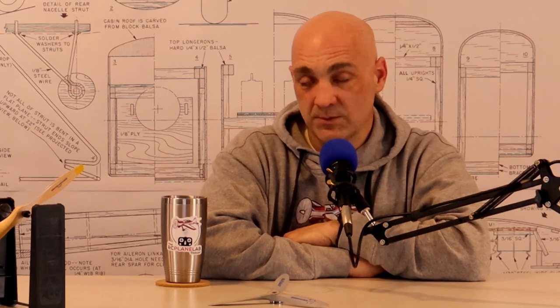It's the same idea. You just figure out a way to mount your spinner onto your spindle and set it on your rollers. I'm pretty sure most spinners come with bushings that you put in the hole to accommodate different shaft sizes. So put the smallest one in there, hopefully that'll fit your spindle, and set it on the rollers and balance it.